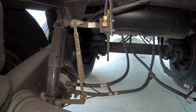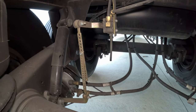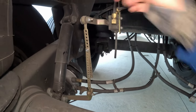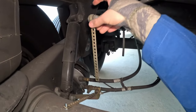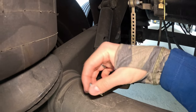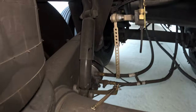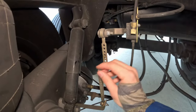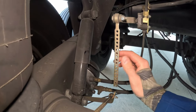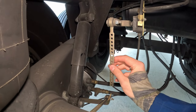This is one of the most common airbag leveling valves on our trailers. What happens is, because of vibration while driving, these bolts fall out and the linkages separate. You can see there are two linkages — they get separated. And when you're driving, the airbags deflate.